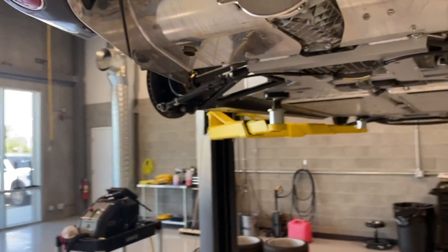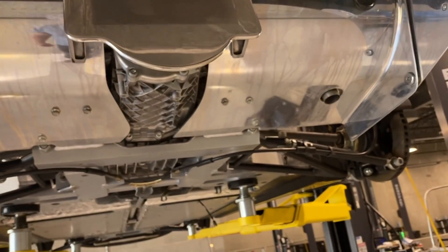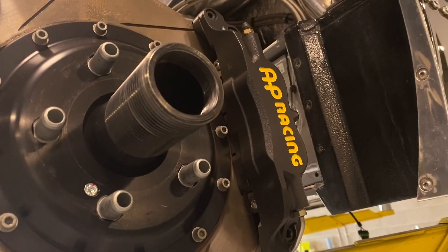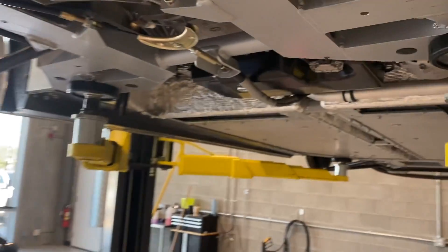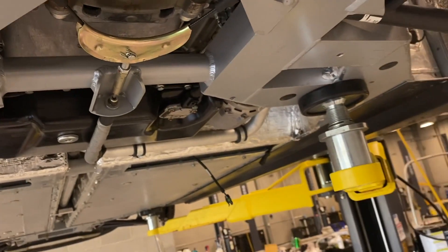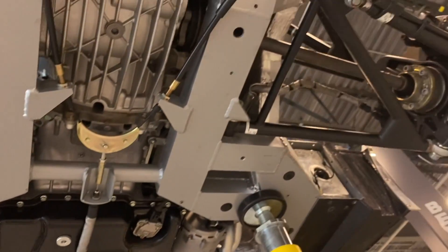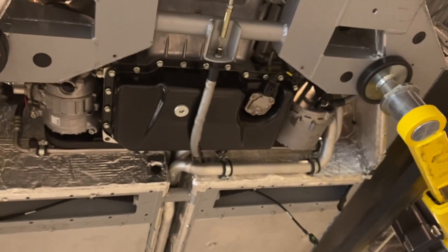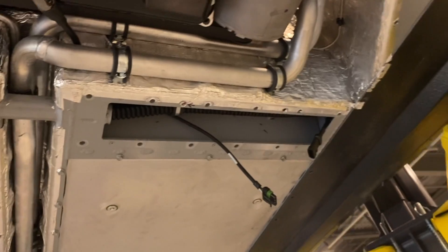Underneath here we can see the aluminum under tray — we still have to polish that. We've got the webbed casing for the gearbox. The Brembo calipers: the big ones are of course for the regular brakes, those smaller ones are for the handbrake. We can see the handbrake cable there. We can see the frame — the way it's built, cradling the passenger compartment and the engine. And there is the bottom of the dry sump engine — you can see there's no sump. Some ancillaries at the bottom, and that looks like the alternator.